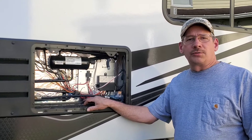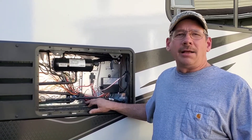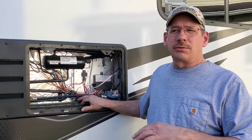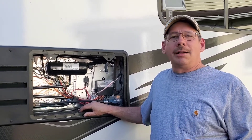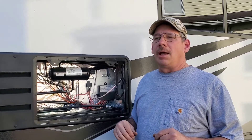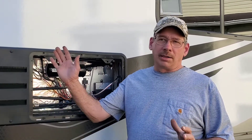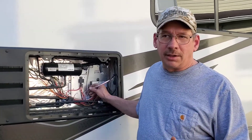We're going to give you a little bonus footage. I've been going over a lot of the wiring. We had a 2013 or 2014 Freedom Express — checked it out when we picked it up, everything was running good. We got it home and the interior lights didn't work. I pulled down one of the pot lights and they had stripped way too much insulation off the wire at the crimp. I went over all the pot lights — that was the whole problem. But this is something I found while I was looking at the refrigerator.